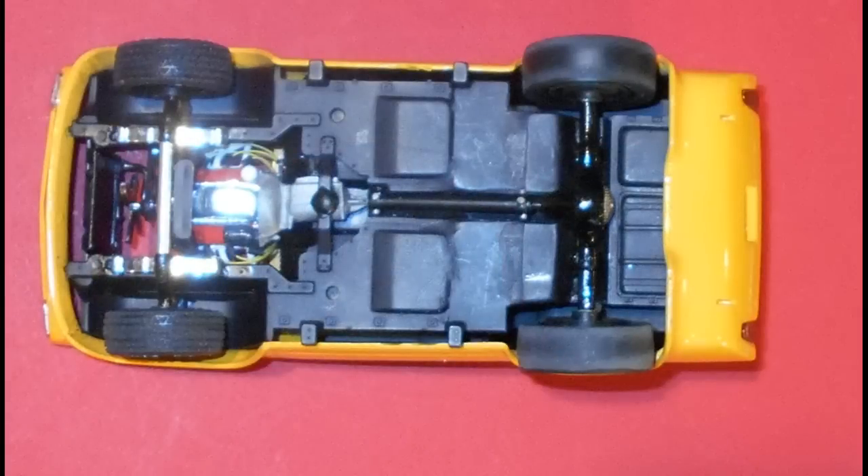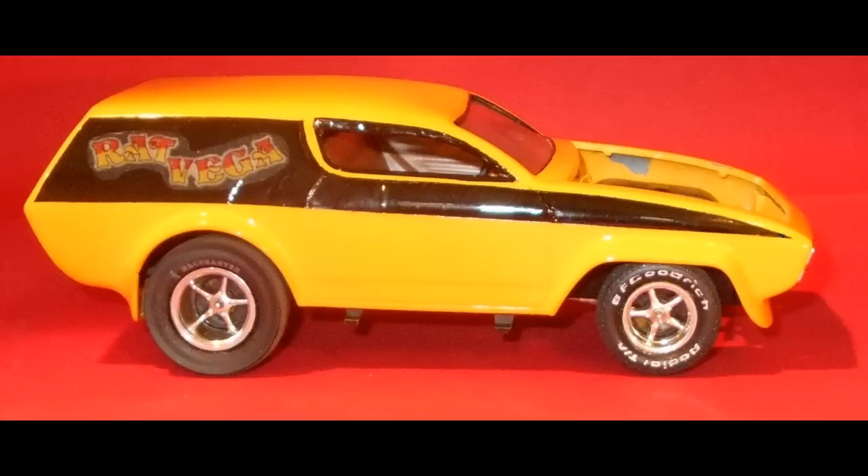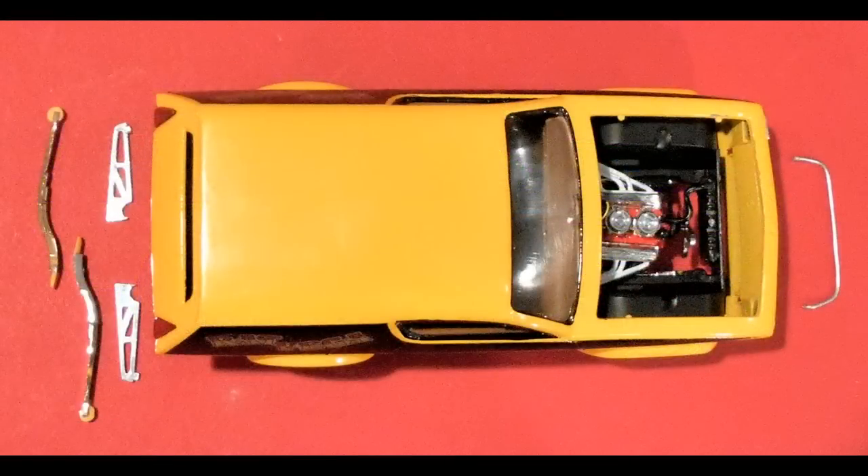You can go ahead and permanently install the wheels on the spindles — make sure they're all straight and true to the plane of the chassis, the driveline, and to the outside as well. The driveshaft can also be manipulated and put into place at this time, so your underside is pretty much finished except for that sway bar in front. The vehicle is starting to come together well and the front end looks more normal with the wheels moved back about 3/16 of an inch. It will be a little tight fit for the headers but they will go in there.